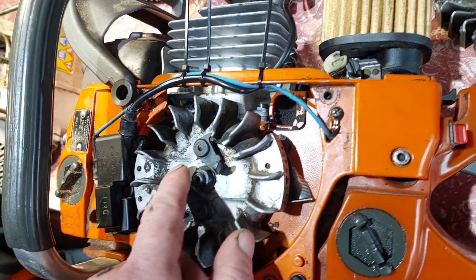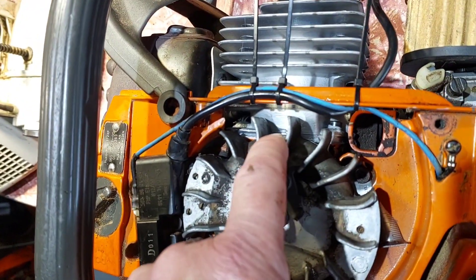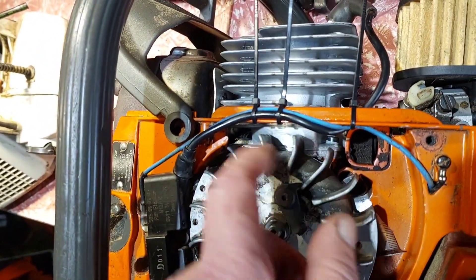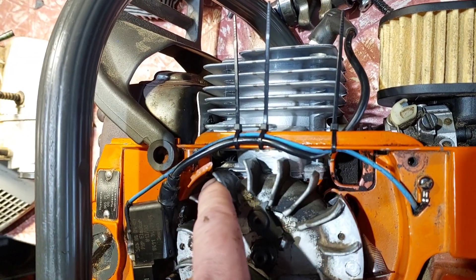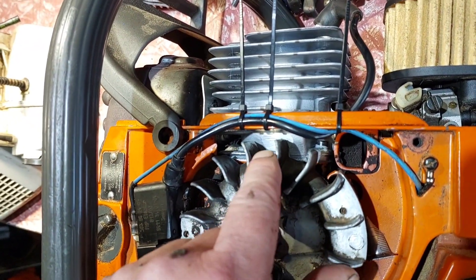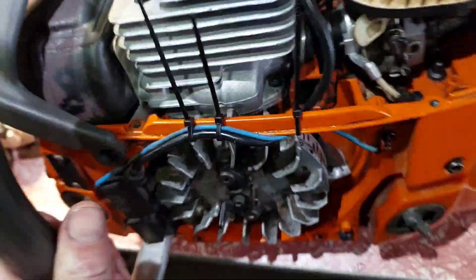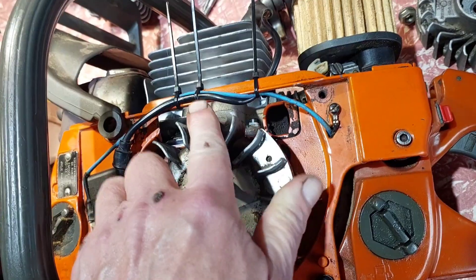I can locate the numbers back to their flywheel and get the timing numbers exactly the same as each other. Funny thing though - this flywheel being factory, the cylinder actually rubbed on that flywheel. Well, the flywheel rubbed on the cylinder but I had ground that back off. I've done it twice to actually get to it - it's pretty tight, timing-wise.